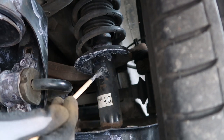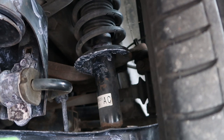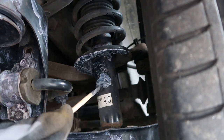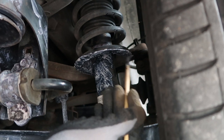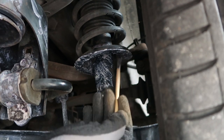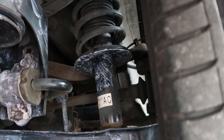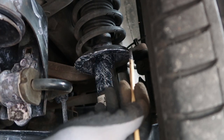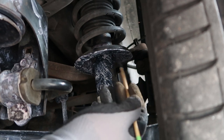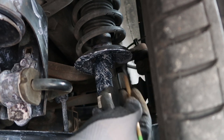Tiny bits of rust now will just be huge in future. When you're talking about connecting suspension and that kind of stuff — when you've got too much rust in certain places, mate, MOT failure all day unless you're getting the dodgy ones. If it's in seams and stuff like that, well you're done. And for most surface rust — you go to a body shop and want surface rust conversion, not talking deep holes and stuff — you're talking 250 quid, straight up.